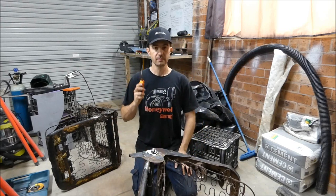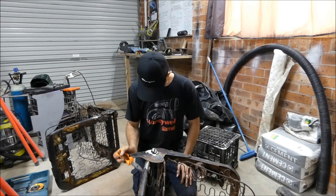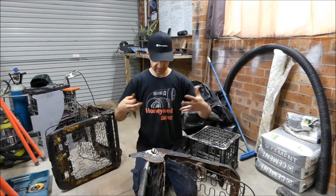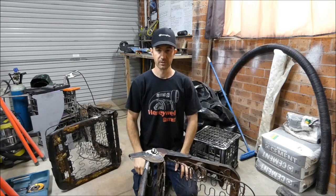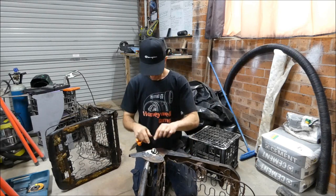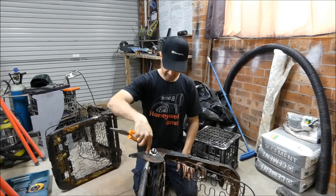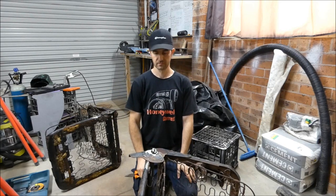And now comes one of the other tricky parts. The part now is there's a spring that runs through the inside of this tube, grabs onto the cam, to keep it in place so that the teeth actually stay together and stay locked, so that the backrest doesn't lever itself out of position. I've got to try and grab that, loop it onto the cam, put the cam around the tube, and then align this base that goes onto the backrest onto the tube as well. Wish me luck.